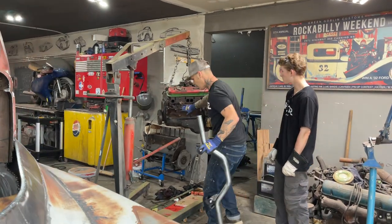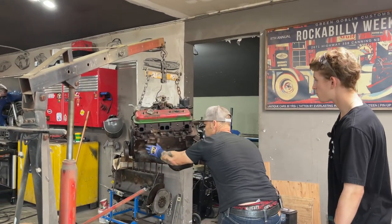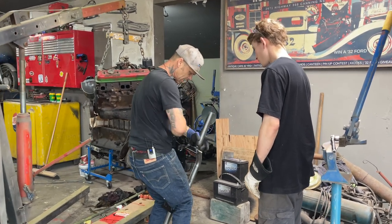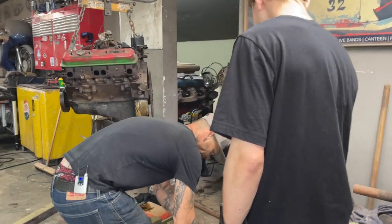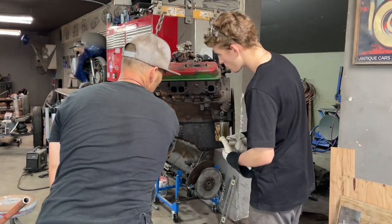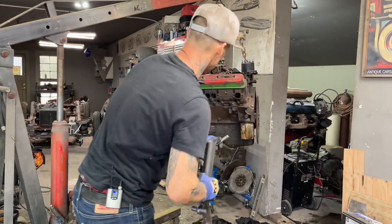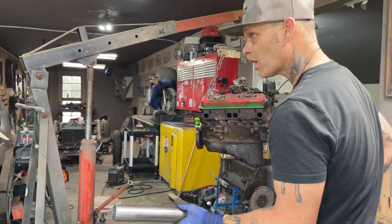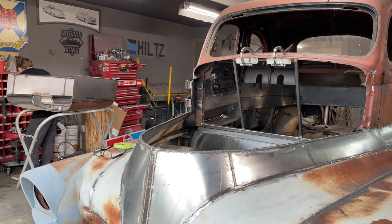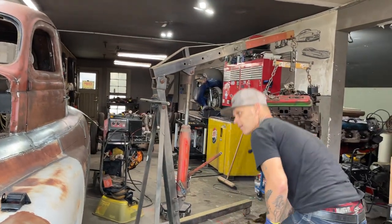This is the mount I'm talking about — got the pipe going across, got two motor mounts, and your two motor mounts that go on your block. I've taken a measurement from the eyes of the holes and what I'm seeing is it's basically the same. We're going to pull this engine across here and try to put it in there and see if that engine fits those mounts. If it does, I'll know what I have to do with the firewall. If that engine fits those motor mounts, we know what it's getting — a small block Chevy.